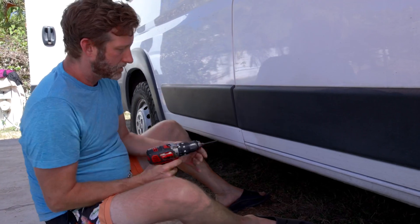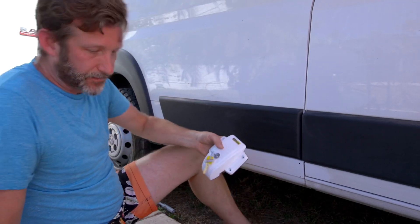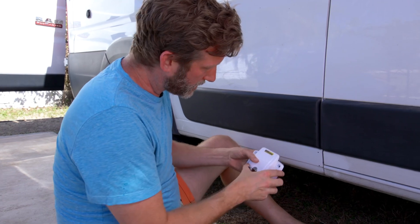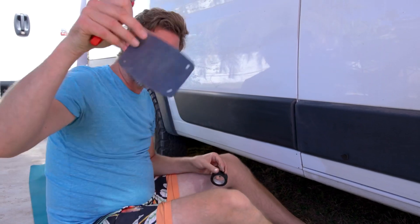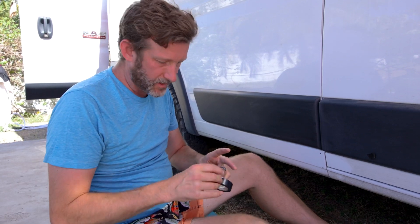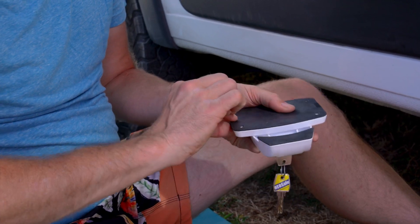Ready to rock. Drilling holes in your own vehicle is not fun. I got my first two holes drilled, and I was about to do the third when I noticed it was a little off — glad I waited. I'm going to mount it with just the two holes first, then drill the remaining holes after so I know they're in the right spot. There's also a rubber mat on the back of the metal plate that keeps moving around, so I'm putting a little tape on the sides to make the rubber mat become part of the metal plate so it doesn't shift while I'm positioning it.